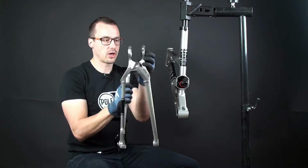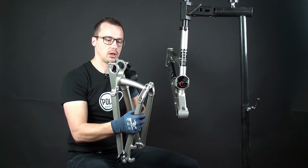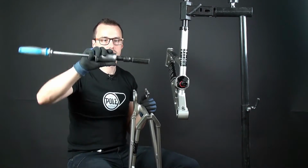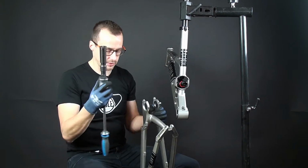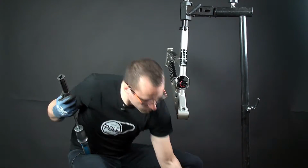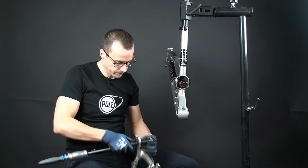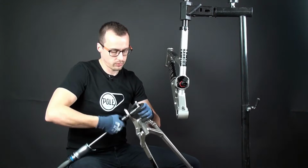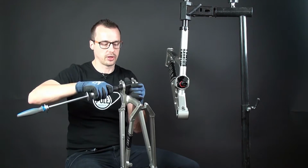and the drive side, it depends what's the tolerance here. You can use this kind of a bearing puller. We have a sliding hammer. Just place it. So this is an easy job. You just place the bearing puller like this, and then you take the bearing out.